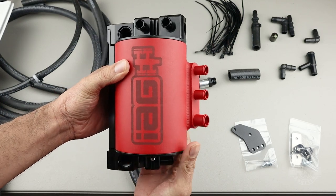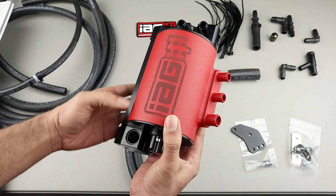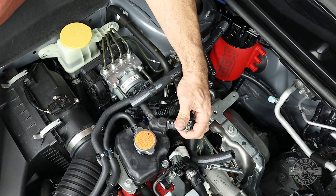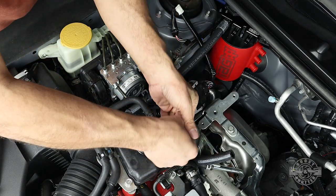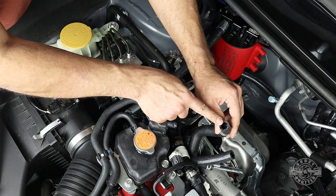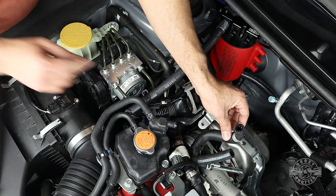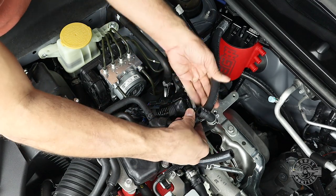Along the side of the air oil separator are two openings, one up top and one down below. Those two openings are for your coolant — you're actually going to route coolant through this. The reason for the coolant is to get the air oil separator as close to the temperature of the engine as possible, which will minimize condensation issues when the car experiences large temperature fluctuations. It should prevent water from collecting within the canister and mixing with the oil. The AOS taps in-line into the coolant reservoir on top.